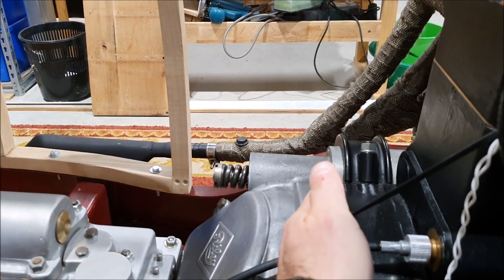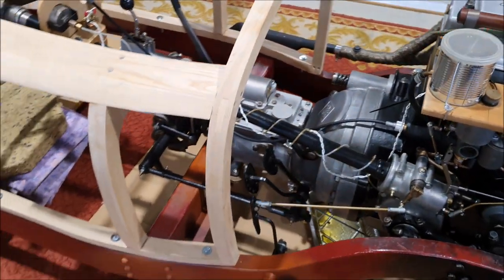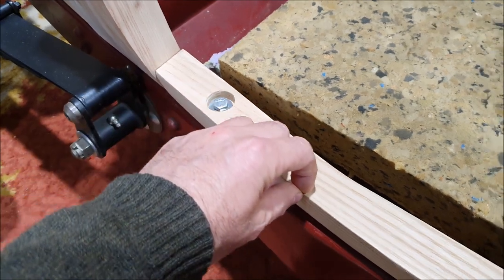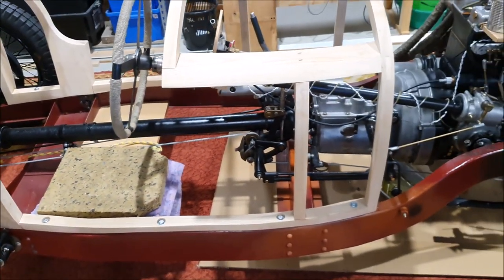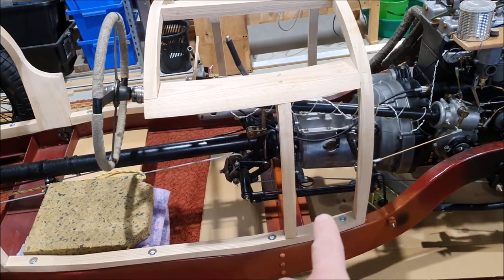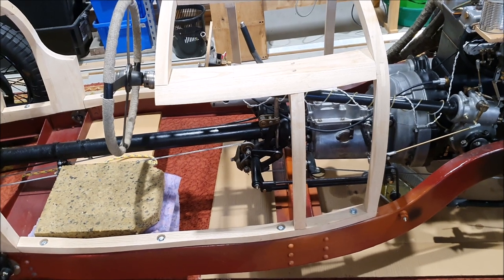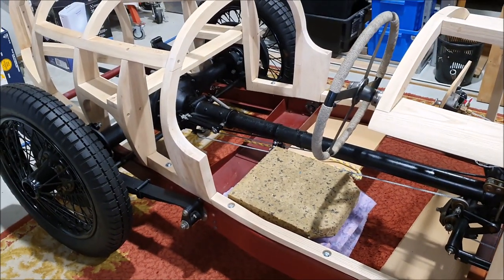The starter gear is actually sticking into the passenger footwell, so that's something to be aware of. There is aluminium that covers the outside of the timber here as well — it comes up and around and sits along the edge. I'll start considering how I'm making all the little metal bits of bracketry that go in there. What I want to do is use the brackets that strengthen all of this to also be what the hinges bolt to — so the hinges won't be screwed into the timber; I'm going to bolt them all the way through with countersunk bolts with nuts on the end to make everything nice and secure.